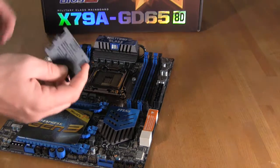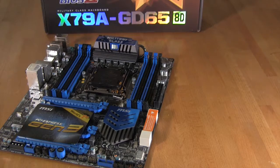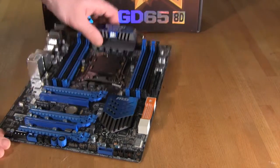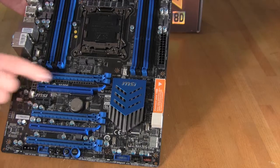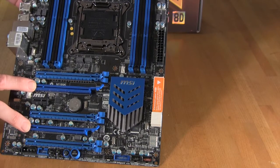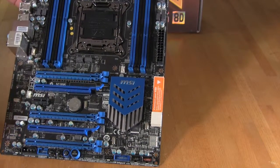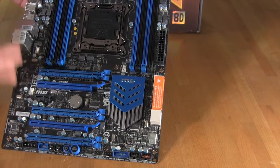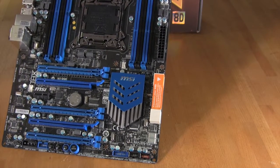There's a sticker over the plastic cover protecting the pins in the LGA socket — unfortunately when we pulled it off, it removed the plastic cap, so be careful if you buy one retail. There's also a sticker covering the PCIe slots. The peripheral slots feature different hold-down clamps because each slot is different: the three with press-down slots are PCIe Generation 3, and two are PCIe Generation 2. You can run a Gen 2 card in slots 2 or 5, and Gen 3 cards in the other three, with no need to adjust BIOS settings.